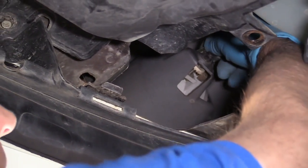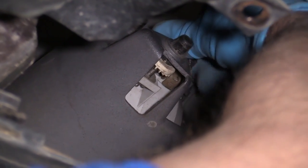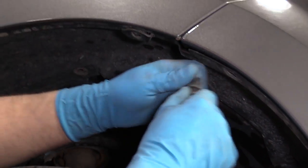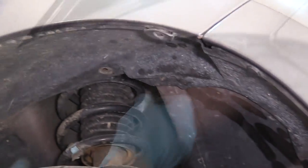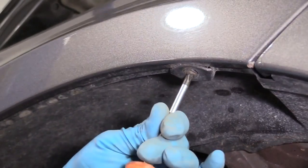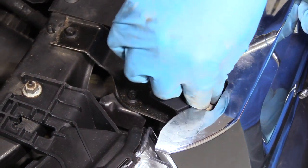Take the fog light — you want to connect the fog light connector. Just line it up and lock it in place, and do the same for the other side. I'm going to put these push pins in on this side. There was one missing here, so I'll put a new one in. Put a push pin right here. Phillips head screw right here — just use a Phillips head screwdriver and snug it up. There's another push pin right under here. Now I'm going to do the same procedure for the other side.